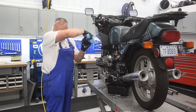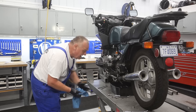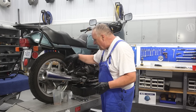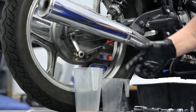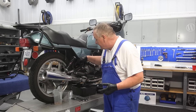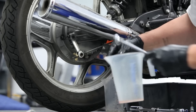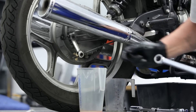That's further indication to me that the gearbox is probably in pretty good shape. Now that's draining nicely, I'll move over to the final drive. Next is to drain the final drive oil. You've got the swing arm oil and the final drive. I like using these graduated beakers to see how much is coming out — it should be 350cc in the final drive and 150cc in the swing arm, so you can see if that's indeed what comes out. Plus the pour spout goes in nicely so the drips don't go onto the side of the tire.